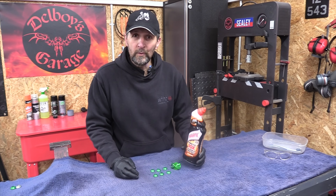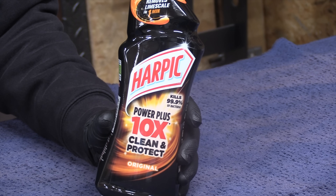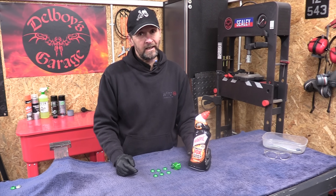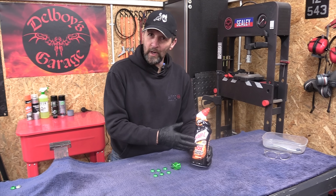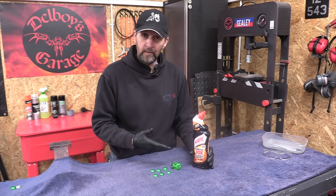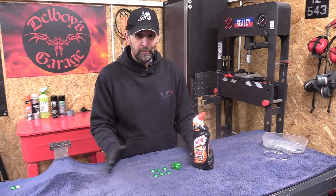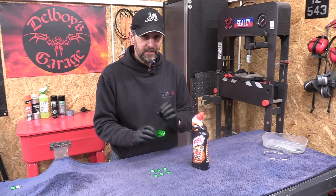Good morning. Now I think we all know by now that Harpic toilet cleaner is the perfect hydrochloric acid mixture to get corrosion and tarnish off your exhaust system — in fact any stainless steel — but it only works really well on stainless steel. On other metals, the acid will eat into chrome and any non-ferrous metals, damaging them and leaving stains that just can't be removed without severe surgery and polishing.